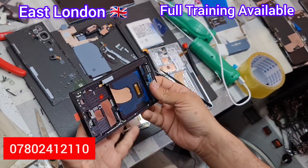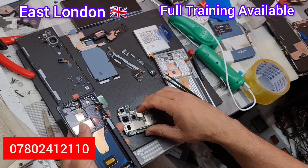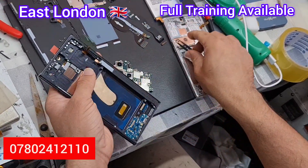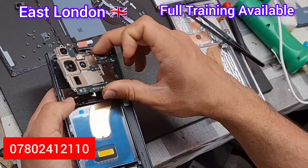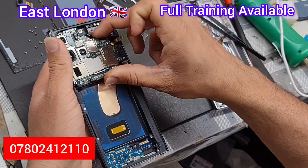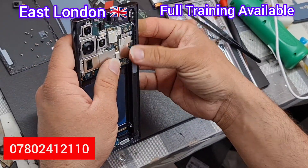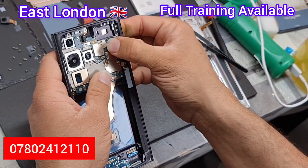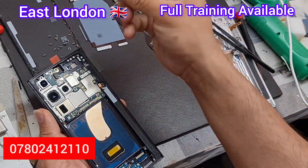The pen is one of those things you easily forget, so put it in and connect the pen flex. Take the flexes out of the way so the motherboard can sit properly — if the flexes are not positioned correctly, the motherboard won't sit right and you risk damage. Attach the pen flex properly and double-check it's connected. Then connect the remaining flexes.